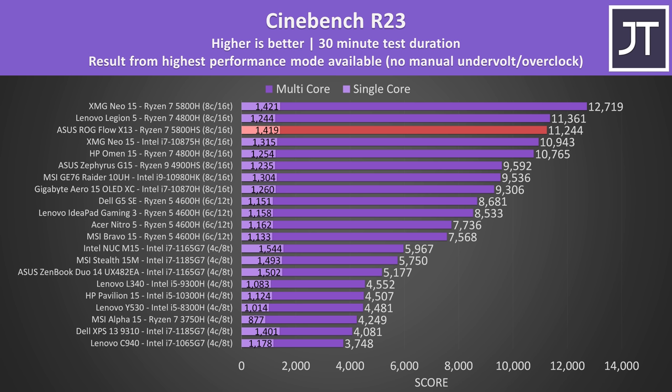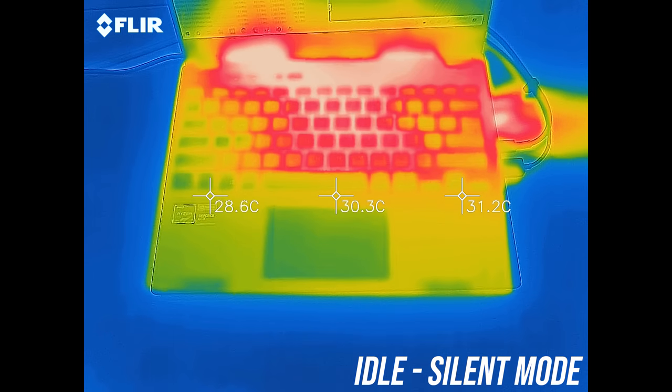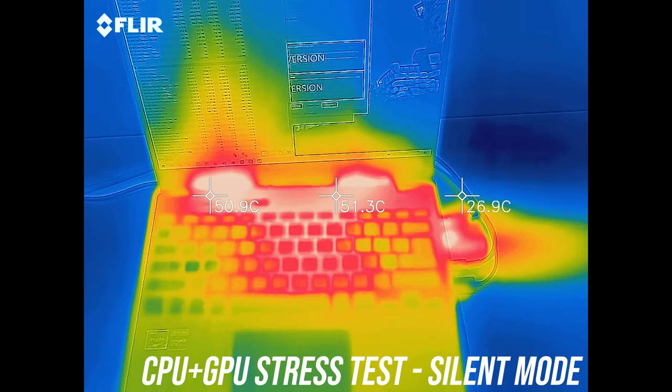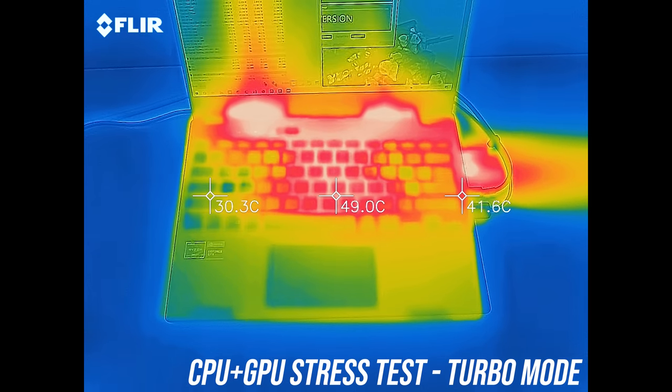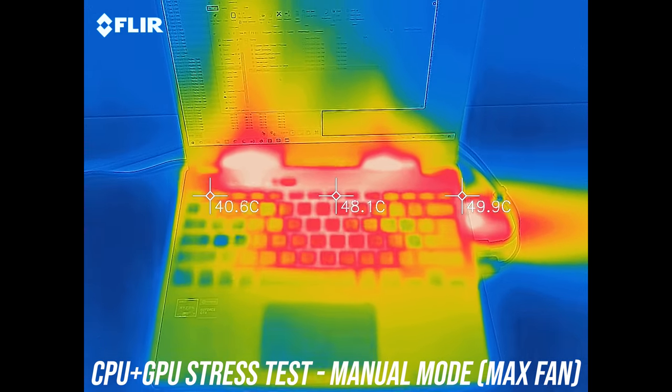The single core score isn't quite as good as some Intel Tiger Lake options, but it's not far behind. Most impressively, the multicore score was able to beat thicker Intel and AMD options. We don't lose too much performance on battery either — single core drops 7 points, and multicore is still one of the best results. Surface temperatures: the X13 was warmer than most when idling, peaking around 50 degrees on the keyboard under stress tests — warm but not bad. Performance mode was similar, fans louder but performing better. Turbo mode was warmer with a hot back panel. Manual mode with fans maxed was toasty but not uncomfortable on the keyboard. With the eGPU in use it's cooler despite the processor running better, as the graphics workload has been offloaded.